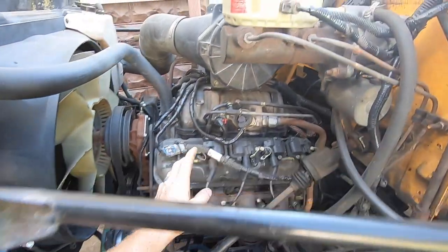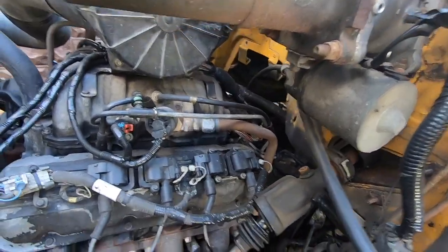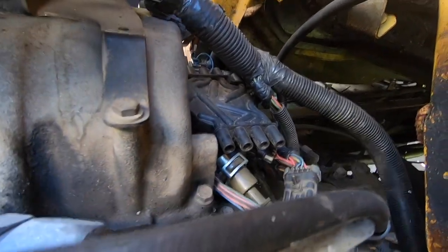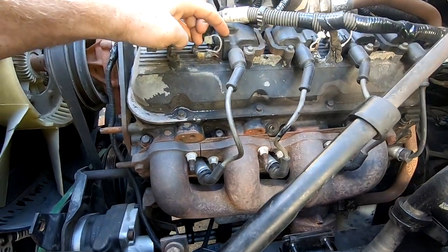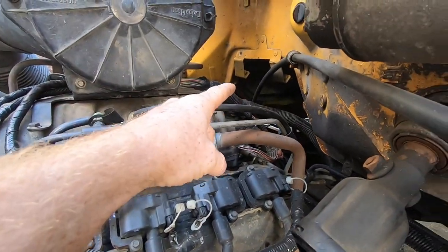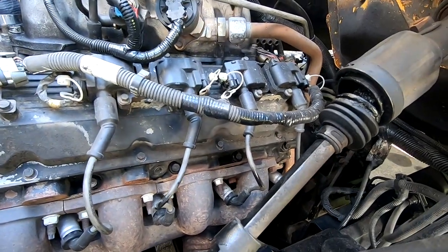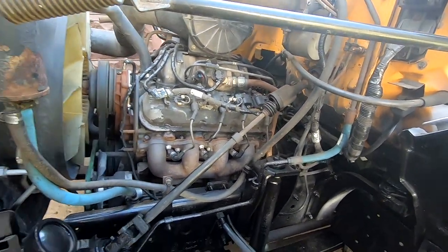When I walked up to this machine, I really didn't know that any fuel injected motors even had distributors. And so there was no cover on the distributor. And then when I went and bought one, it came with that cap there that has spark plug holes on it. And I thought, what the heck? Where in the world? That makes no sense. Because usually you have a spark plug wire that comes from a coil pack down to your spark plug itself, and that wire doesn't ever go to the distributor on a fuel injected engine. What this motor is doing is it's using that distributor as a cam sensor. So the little plug we plug into it, all it does is sense where the cam's at so it can tell the computer when to fire.